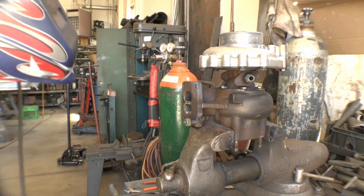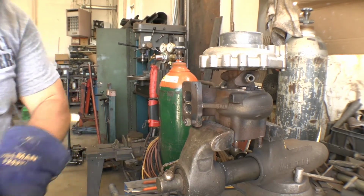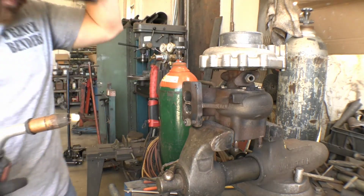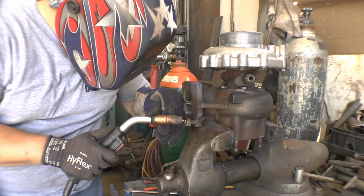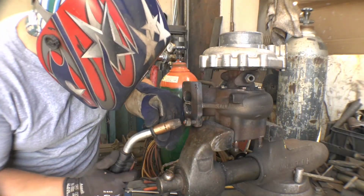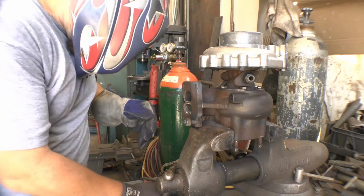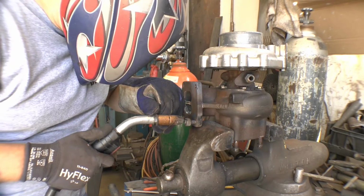And you always want to make sure that your welding lead is good and straight and there's no loops in it, because if there is, it'll give a place for it to bind and it won't feed your wire at the right speed sometimes. So, welder on. Well, I can't get a good ground there. There we go. My clamp wasn't making a good ground on the table.